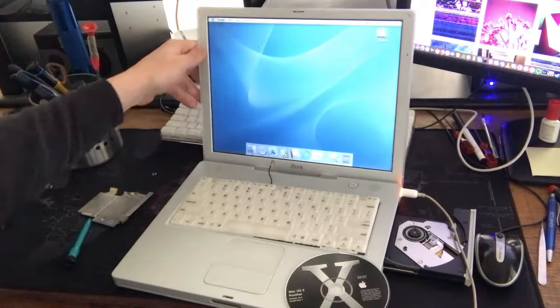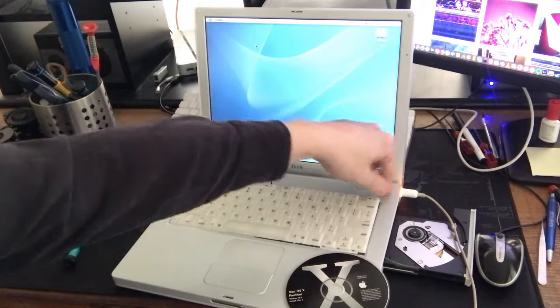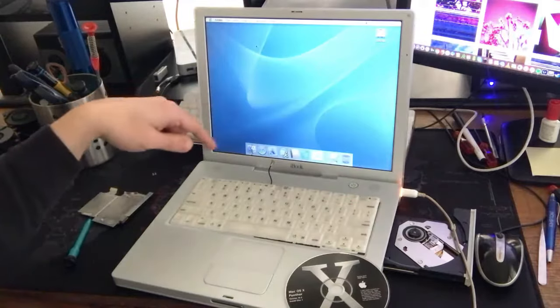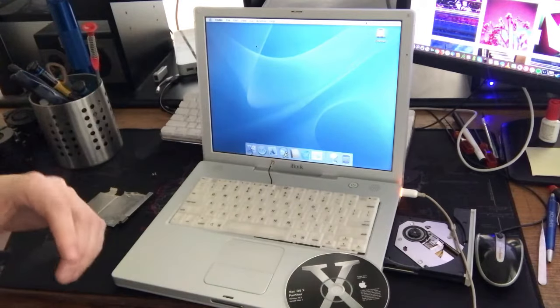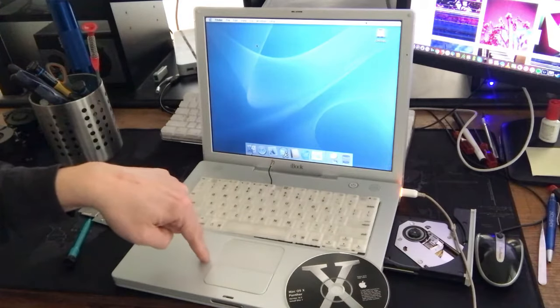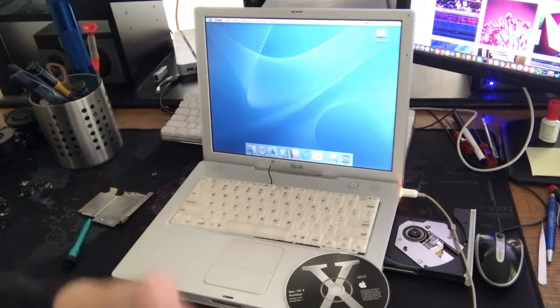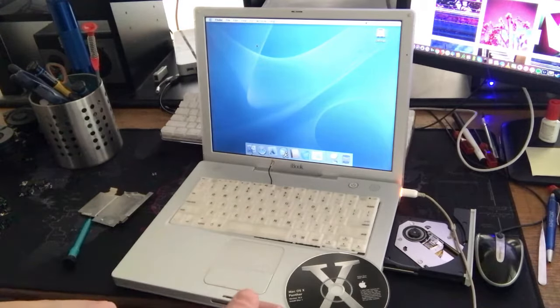These have a removable DC in, as do most Apple laptops. The DC in is the component that the AC adapter connector goes into. Removable DC ins are nice. This one's right here, you screw it in, and there's a cable connecting to the underside of the board. They're nice because if the power system gets fried or zapped, you can just replace that, or even just disconnect it temporarily and then plug it back in once it's discharged. And you don't need a new board. A lot of manufacturers, the DC in is part of the board. So if that gets screwed up, you're replacing a whole board.